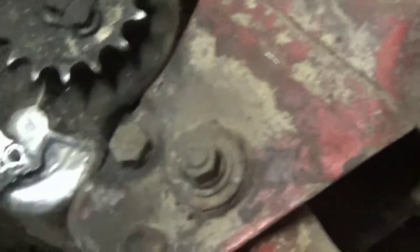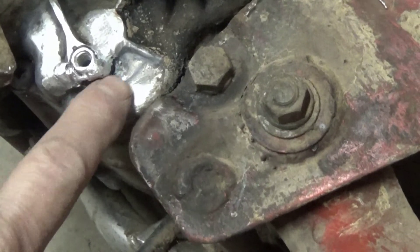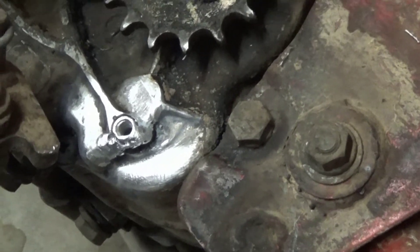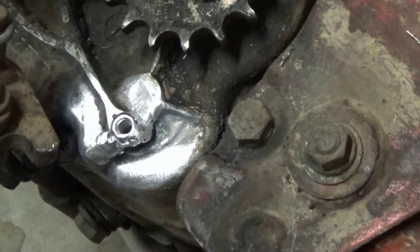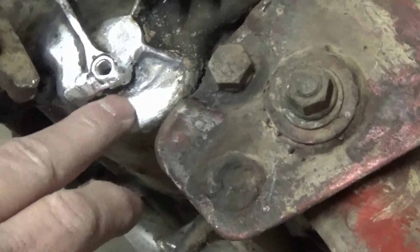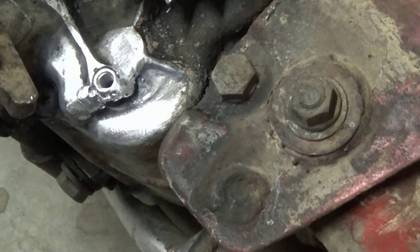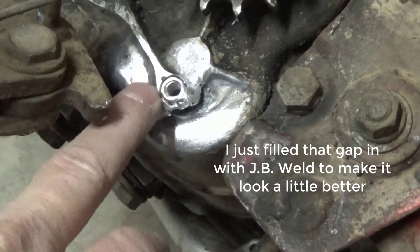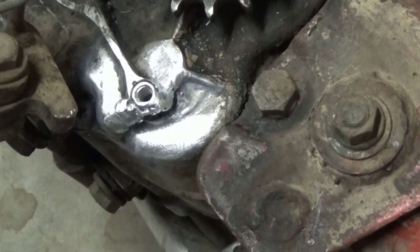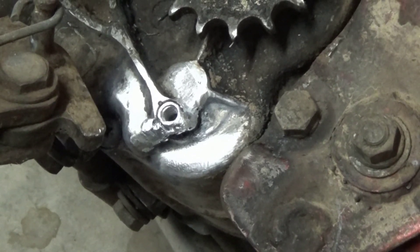I brazed it and wire brushed it off. It can be dressed up with some grinding wheels better, and I'd like to get it to flow into the bottom a little better. But the whole goal is just to get this bike back on the road, or actually just get it running again. We're planning on rebuilding the engine and I'll do a video on that — when I've got the crankcase apart and less aluminum to heat up, it'll be easier. Aluminum dissipates heat so fast it's hard to get it right. The biggest thing was to show you how to rasp out the hole carefully, take a little bit at a time until you get your rivet insert with threads put in there, and then epoxy it or if you have a MIG or TIG just spot it in. And that's how you fix a broken threaded ear on a small motorcycle engine.